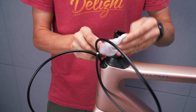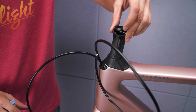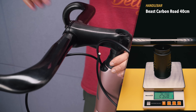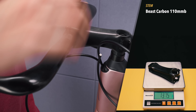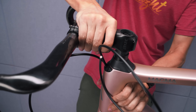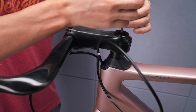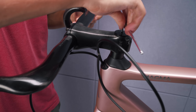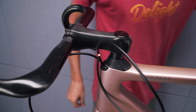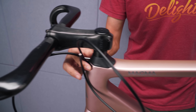So gravity helped keep everything together anyway. Expander torque to spec, 8 Nm. Clean off any remnants of grease on the steerer tube. On with the two spacers and the cockpit to secure everything. And I have to say this carbon Beast stem is super tight — it was an even tighter fit than my THM stem, which was also super tight. I don't know if this is a thing with carbon stems; they need to be tighter not to put too much stress on the carbon when tightening the bolts, but definitely different from a normal aluminium stem that you can easily just slide over the steerer tube. Just an observation.